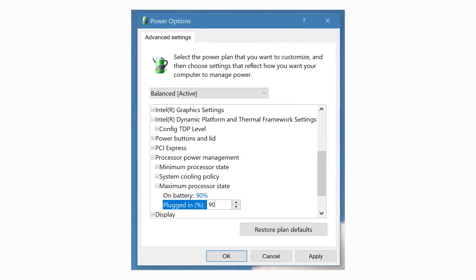So how do we save power? The answer is pretty simple: software limiting. Inside Windows, since around Windows XP times, you can change the power management settings and choose how much of the CPU you want to run. You can jump into the settings window and set the CPU to go no higher than 50% utilization. If a task wants to max out the CPU, Windows will limit it at 50%, which takes longer but saves power. The benefit is that all cores remain enabled so you can still hit those low power states — and when you need full power, it's just one button press away rather than rebooting into BIOS.